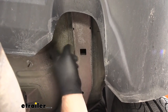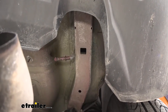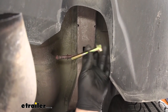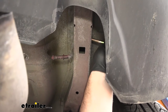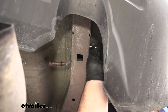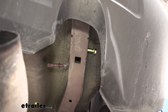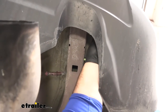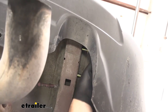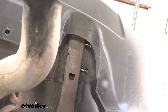We're going to have two holes in each frame rail that go all the way through, and one more as well — you're going to have that on both sides. You're going to take a long hex bolt, put a flat washer on, go from the outside, slide it through like that, and then let it rest. You want to make sure the end's not sticking out. We're going to do that in each one of our holes. Then once we get our hitch up into place, we can take this, slide it over into place, and it'll support the hitch.